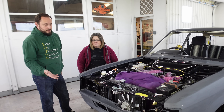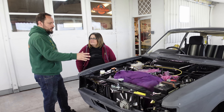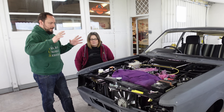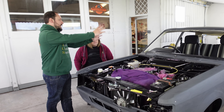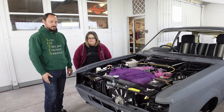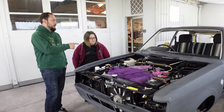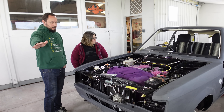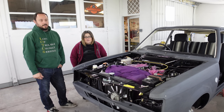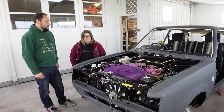This car, because it was finished when it came in, weirdly it's full of silicones from a detailer. So I need to wrap up everything in the engine bay and the interior to keep those silicones contained within the car. Silicone will ruin your paint job — there's enough inside that car to destroy the entire paint job I'm about to do. So it's mega cleaning and mega, mega tight masking on this one. Lots of plastic — get it wrapped up.